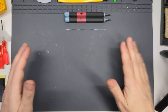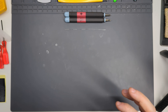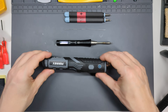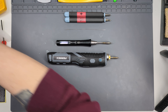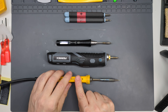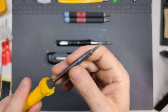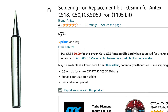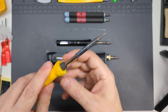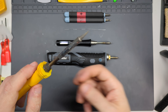The initial stumbling block for people who haven't soldered before is equipment. I've got a range of three different soldering irons: my MiniWare TS-80P, a cheap cordless one from Aldi, and my trusty mains-powered Antex CS-18. All three will do the same job and all three have interchangeable tips — you can change the shape of the end. For Game Boy mods, a pointed tip is generally the easiest to use. It's more about planning how you're actually working and being quick and efficient rather than rushing.